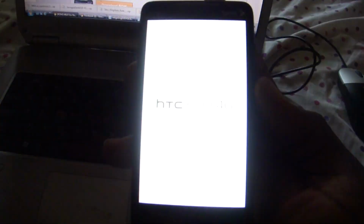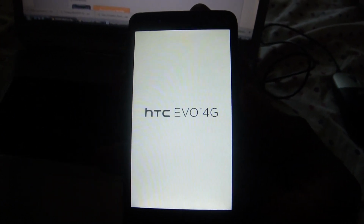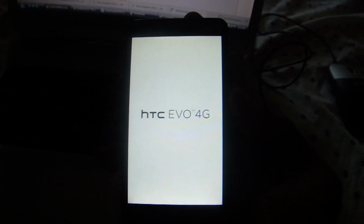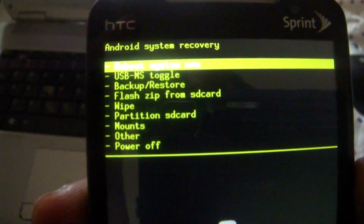There should be another screen that you'll be in, but you want to just press the down button, go to the second menu option, which is recovery, and flash into recovery mode. Once you hit that recovery menu, you're going to get to this screen, HTC Evo 4G, and that's normal. It's going to take a little second, and you should be up and running. Depending on where you automatically have your file saved, it's going to be where the folder is. And I should know where it is.